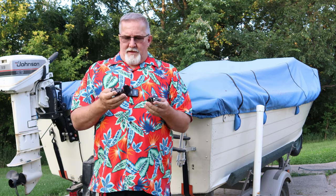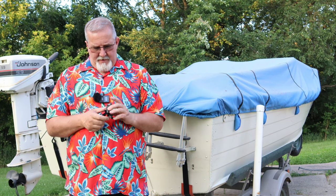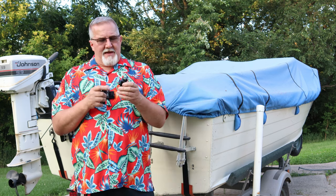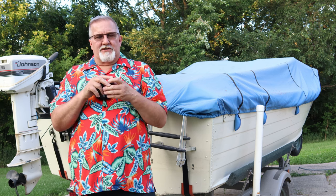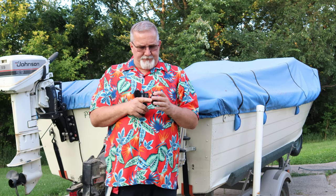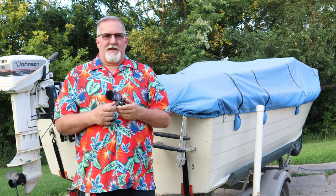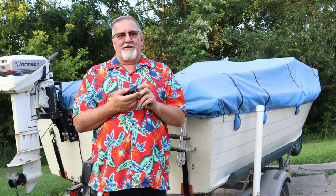These. And yes, walking out to do this video, I dropped one. Where'd it go? These are like a phenolic. These are the things your household breakers are made out of. It's very hard, very brittle plastic. And it's brittle for a reason. It's tough, but doesn't take a lot of shock, but will protect your electrical circuits and sparks from getting outside of it when it trips. So I dropped it and I cracked it. And the piece went in there and it quit working like it should. I'm kind of disappointed in myself for dropping it. Well, it was drop this or drop the camera, so I dropped this. But I'm going to bring you in close and show you what these look like.